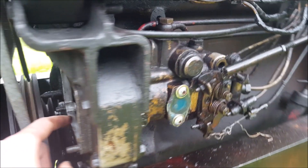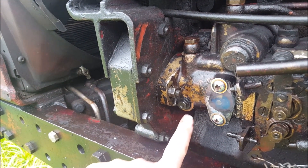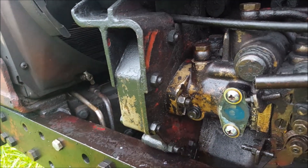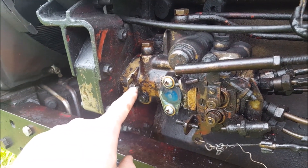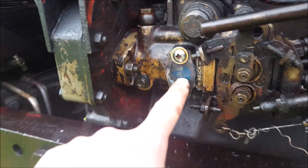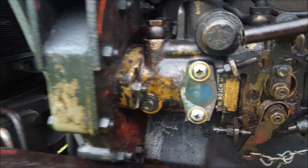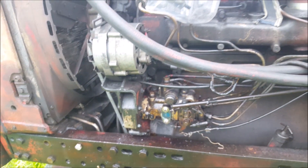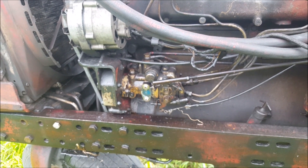You can also get a little bit of movement by loosening this nut and the one like it on the other side, and you can actually rotate the pump itself just a hair. It's not the easiest thing to do because these fuel lines are really stiff. But you can adjust a little bit until the silver line in the black wheel lines up with the flat head indicator, and then you know that your engine injection pump is in time with the pistons like it should be.